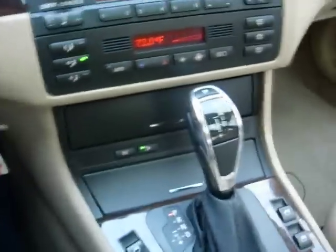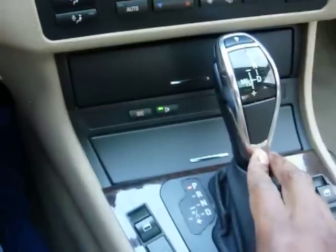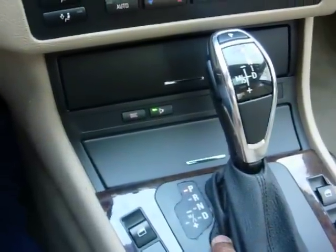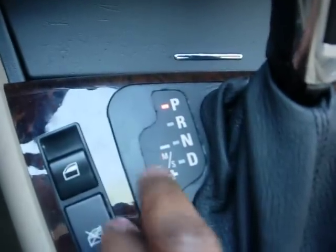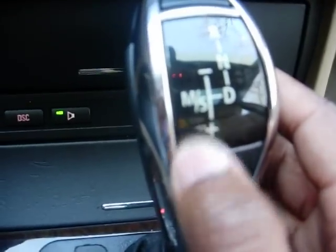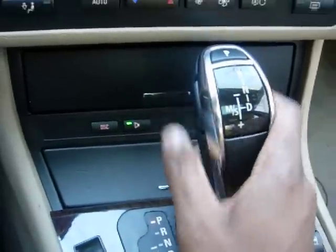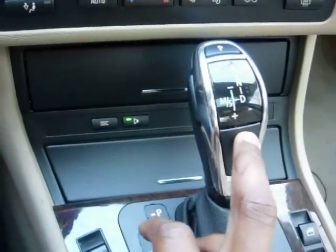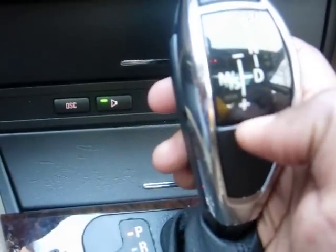This is a quick video to coincide with the shift knob upgrade on a 2001 330i BMW sedan. My car is an E46, and E46 cars before 2002 had a different plate where positive was up and negative was down. The shift knob I upgraded with is from a 2009 facelift 5 series — from 2008 onwards those come with these knobs in the Sport Steptronic package. The new Z4 also has these knobs in the sports Steptronic package. This knob has negative above positive, so if your car is 2001 or older, your plate will not match that.